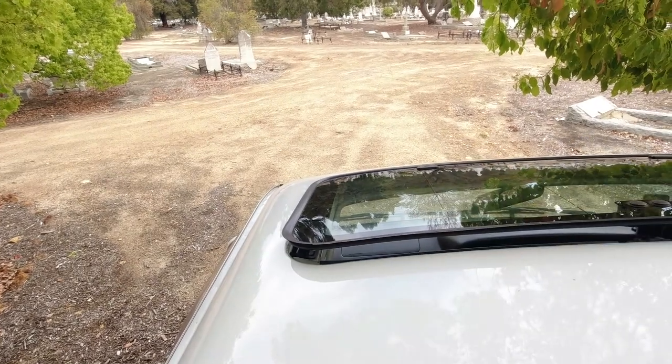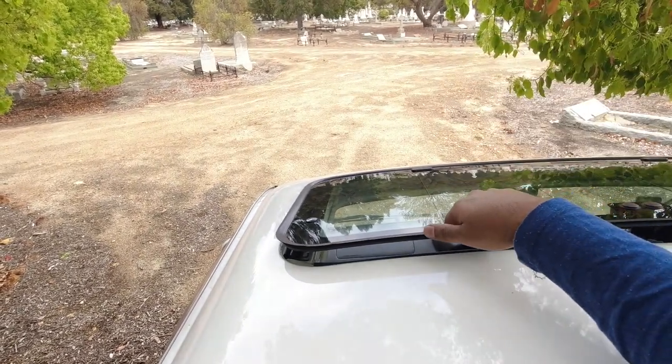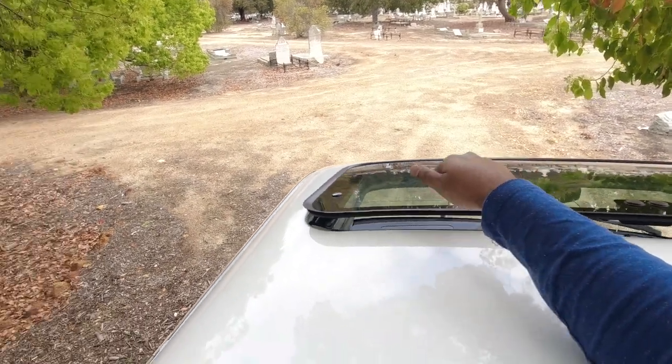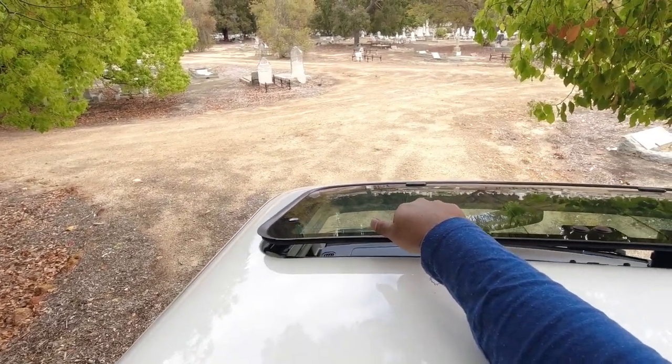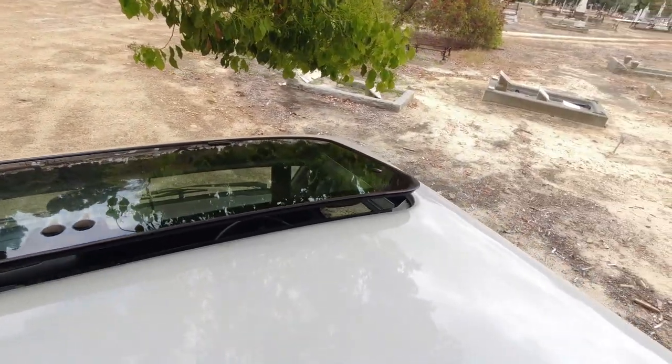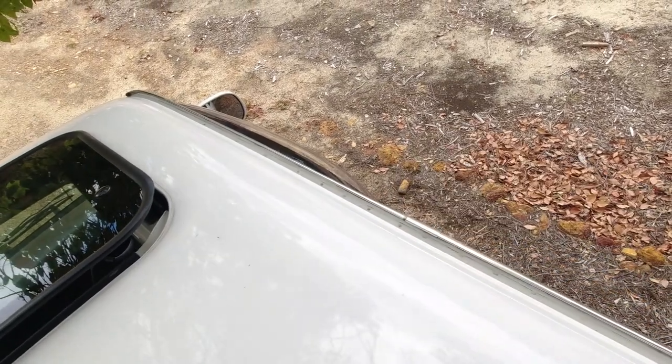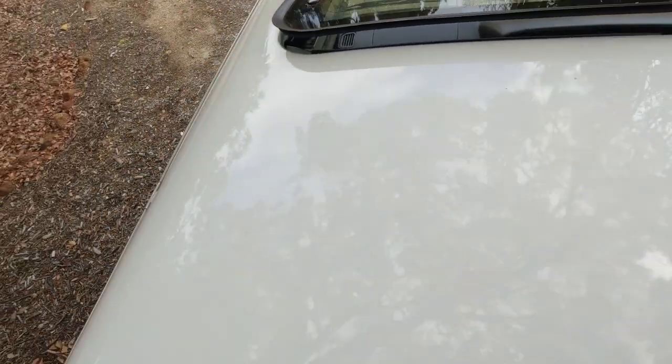And another tip, when you own the car, before you go into underground car parks, always best practice just to drop all the sunroofs, especially this one and the last one, which lifts up even further. So you're looking at the rain gutters that we looked at before on the underside, but now you're looking at the top of the rain gutters, making sure that they're not rusted through. There's no bits of corrosion on them. Both sides, these look very nice. Oh, where's the camera? Where am I pointing? There, both sides look nice.